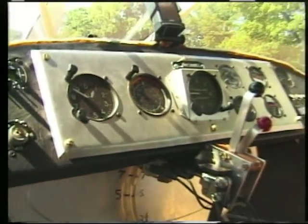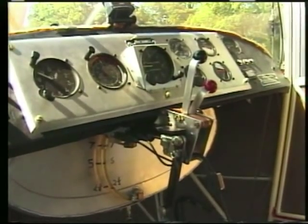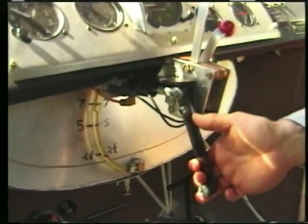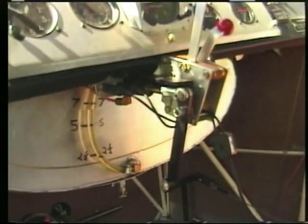The brake system on this airplane is a little different than the standard airplane that we fly today. Brakes are interesting to people — most think of stopping only, but our purpose for brakes in a plane includes doing our run-up, stopping on taxiways, and before takeoff, not just for landing. On my first airplane I put differential braking — heel brakes instead of toe brakes — and I could hold one and give a lot of prop and turn quick. But I found the large rudder control and nose wheel steering meant I didn't really need that, so on this plane I just put a single hand brake to hold and stop. It works great.